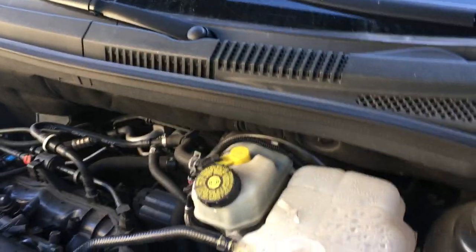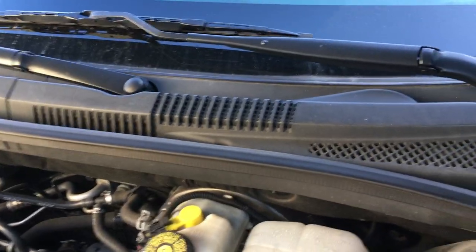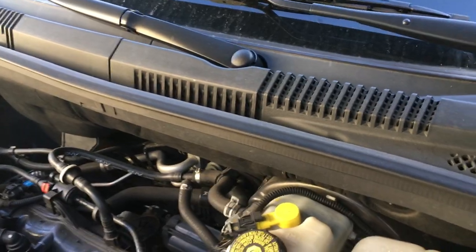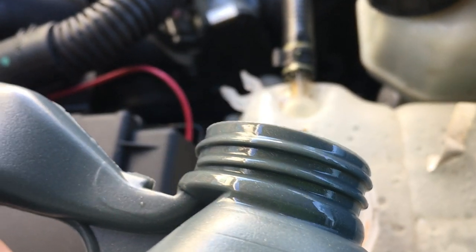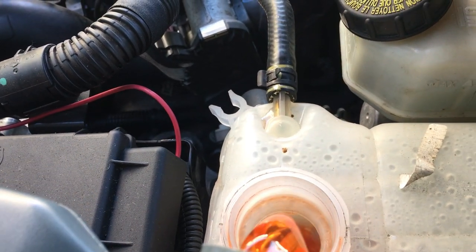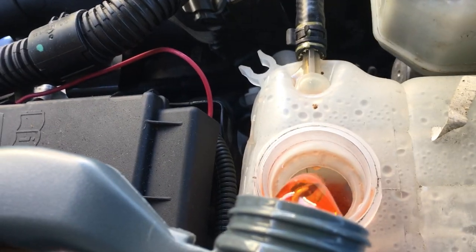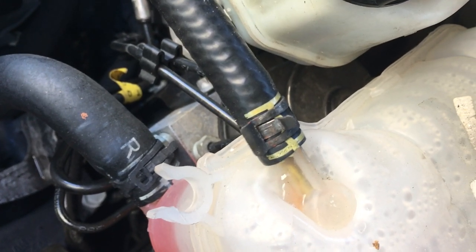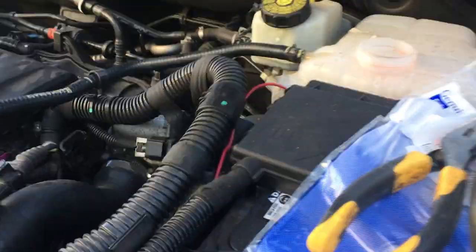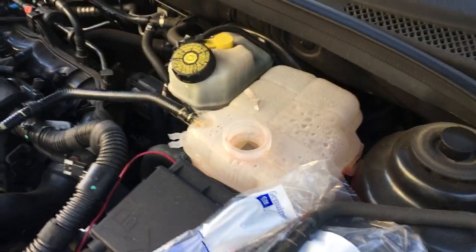Full blast heaters — full blast. Add it up just about to a peak of the line. Don't overfill it the first time because you are going to need to fill it up more. Outside of that, just let the engine run for about 5 minutes to let all the air bubbles out.